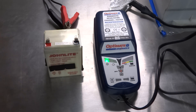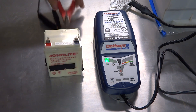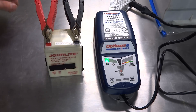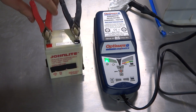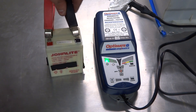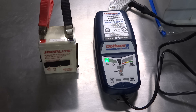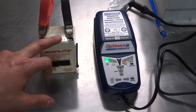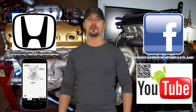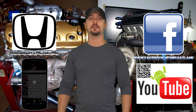This is the very first time the OptiMate 6 has touched this battery, so let's see what happens. I'm going to clip negative to negative and positive to positive — and from what I'm seeing, absolutely nothing. I'm guessing this battery is completely shot — the lead inside has split apart and it's not making any contact. At least this confirms that when the multimeter was scrambling it was showing me a true open circuit. Hope you guys enjoyed this video — go ahead and comment, like, and subscribe. Check out my Facebook page, website, and Android app in the about section on my YouTube channel. I'm In the Fast Lane and I'll see you guys next time.